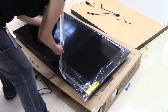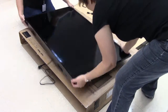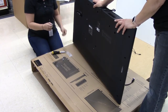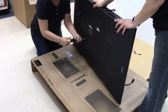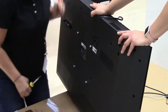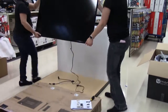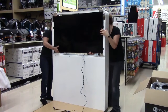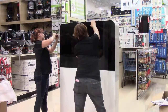You're now ready to install your first TV. Start by removing all the protective plastic film from the TV. Tip the TV up and install the four mounting screws included in the hardware box to the back side of the TV. Note that the instructions say to hand tighten the screws until they bottom out. However, if the screws screw all the way in, you'll need to back them out slightly so that the head of the screws will fit properly into the snowman holes on the center wall bracket and hold the TV firmly in place. At this point, plug in one of the HDMI cables into HDMI port one on the back side of the TV and plug the TV's power cable into the power strip.